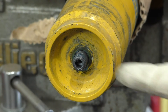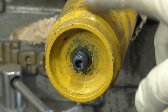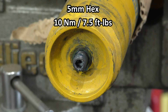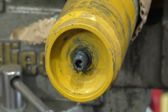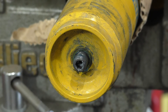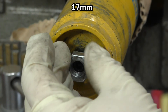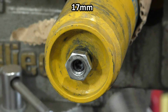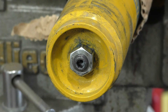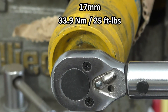Now I admit I don't know exactly what the torque spec is supposed to be when securing the piston shaft to the strut body, but at least when I do it by hand and check later it always ends up being about 10 newton meters or 7.5 foot-pounds, so that seems to have worked well for me. Now that the piston shaft is secured, we can go ahead and take the 17mm nut and put that back on. Not an official torque spec, but I usually do this 17mm nut to 25 foot-pounds.